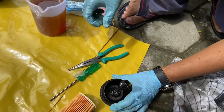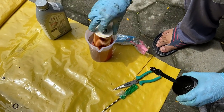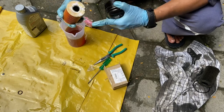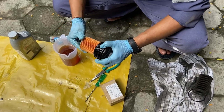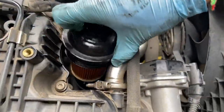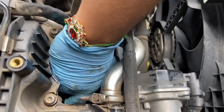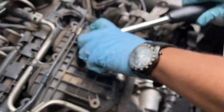All the O-rings are in place. We're going to prime this filter — just dip it once. The filter goes in only one direction so be careful about that. Once your filter is primed, notice that the lettering part goes to the top side — they have written 'top.' Insert it firmly and cleanly into the cavity; it's going to take a little bit of prodding. Just do some basic hand-tightening and then tighten it with the spanner. Tighten the filter assembly back.